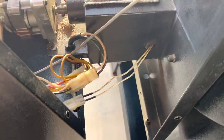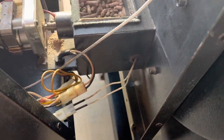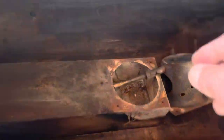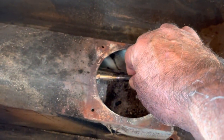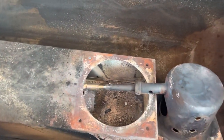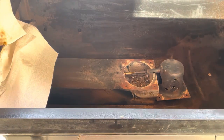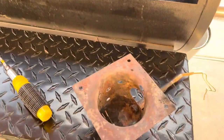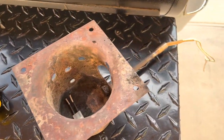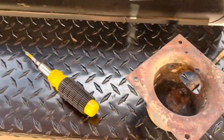The igniter wire is the two white wires coming out of the grill. Normally we would feed this igniter back through, but we're going to have to cut it because I can't get it loose where that screw is broken off. We'll get the new one out and get it assembled. I just needed to clip that fitting so we could pull the old fire pot back through.